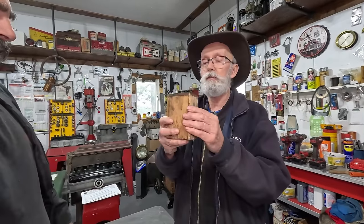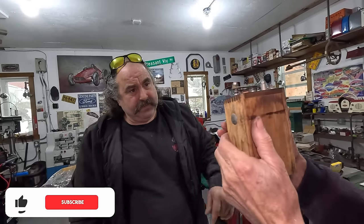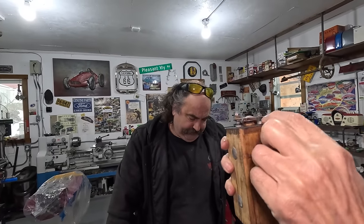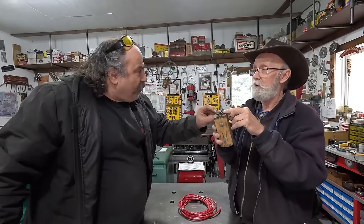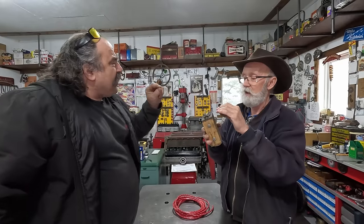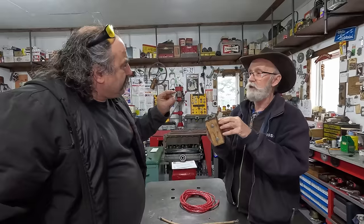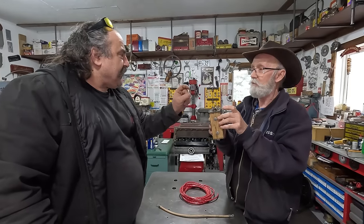What does that do on top? This is what they call the vibrator part — there are little points in here that come down. You can see a set of points that open up. There's a second set of points up underneath this piece here, and when you push down on it you'll see them pop down a bit — that's what vibrates. It'll vibrate like crazy. Hence, it'll collapse the coil — when it vibrates, it's collapsing the coil, vibrating all the time, shooting a spark. The capacitor's in here and it does that at a very high speed rate — it'll shoot a spark like that all day long. It's a very interesting system.